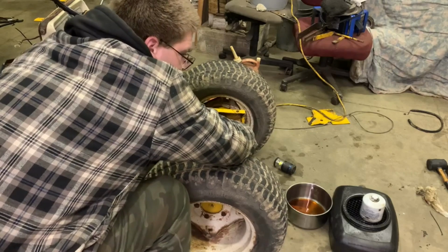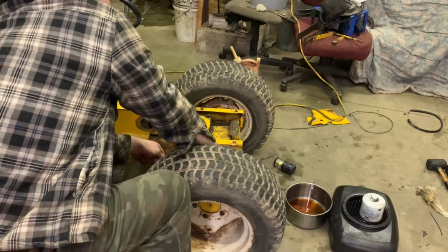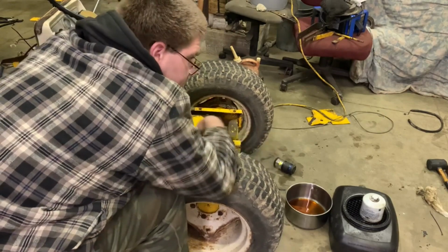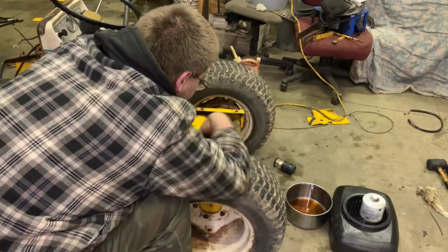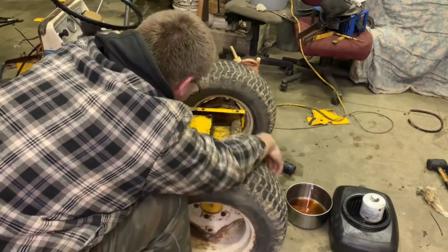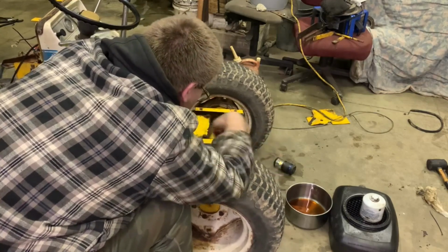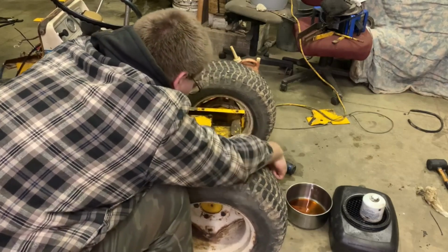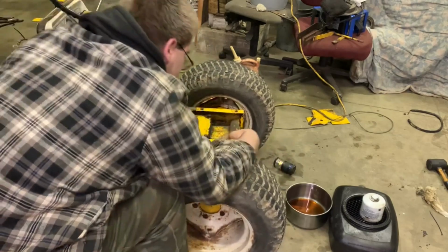Normally I go over and I chase threads. These 2, I don't think I'm going to because they go into the axle. And I really don't want to get chips into the axle or dirt for that matter. And the pump. So, okay. We are just going to throw it like this. Yeah, that goes in fairly far.